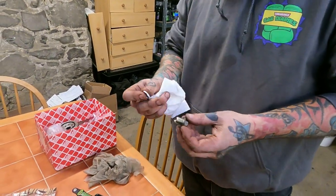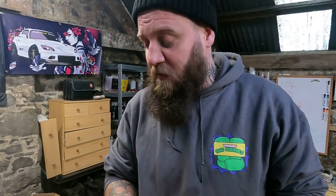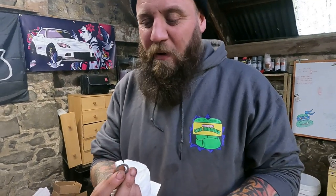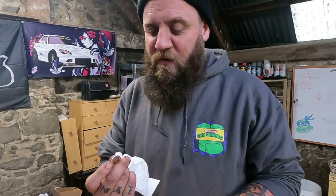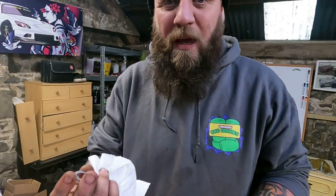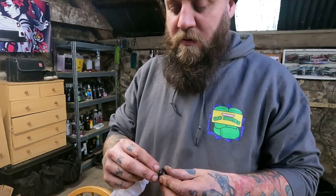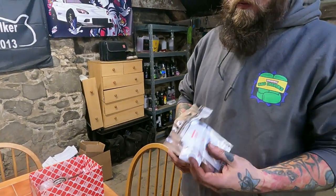This Honda filter didn't come with a washer. Cox Motorparts is a really good place for OEM bits and bobs — clips, washers and that. Inspect your old washer; mine was actually in pretty good nick. It's more of a crush washer, but for the sake of about 40p you really should change it. Slide the new one on — happy days. It's still draining.